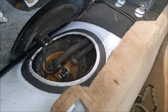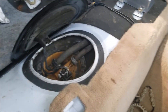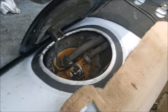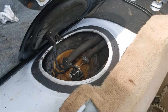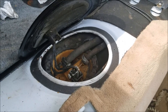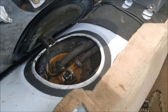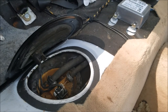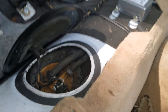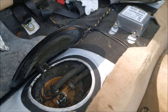So that tells me it wasn't the fuel pump. If your fuel pump wasn't doing that when you're trying to start the car, then it's more than likely you need a new fuel pump. Also, if you are going to change your fuel pump, go ahead and change the filter as well. The fuel filter is very cheap — like 10 to 15 bucks. If your fuel pump's gone and you've never changed your filter, it's a good idea to change your filter as well. It is located underneath the car and it's very easy to get to.